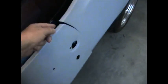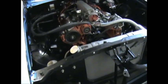Did the same thing on the driver's side, again from here all the way down to here, and that measured 110. Matt with Shut Your Face Garage and Nick Rare Rat both sat there and said, well, you can jockey the door around, and you can see I got excellent gaps on the door. They're a tight 3/16. In the back, you can grab a 16th and maybe shove the fender back, get the 1/8 to sit there and make up the difference on the hood. But the bottom line is the hood's still off. Regardless of what anybody says, this hood's still off.